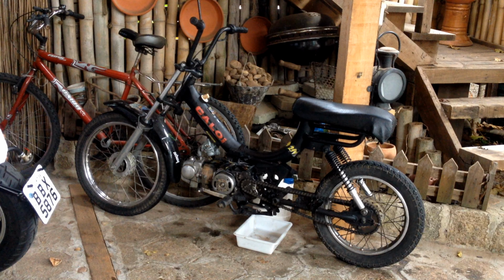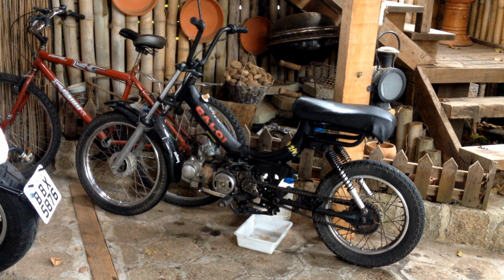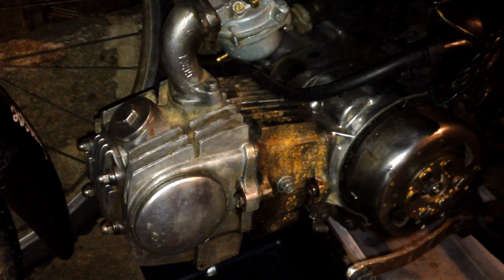And by high-octane, I mean it's the type of gasoline that they sell here in Brazil that has additives to clean the engine. It has detergents that will remove crud from the valves and the cylinder top and the cylinder walls. It's going to remove that crud, that carbonization. It's going to dilute it, and it's going to get burned off with the combustion. And of course, I was freaking out when I saw oil dripping from the exhaust, but then I recalled that I was running two-stroke mixture on this engine, and that's why I was having oil dripping out of the exhaust pipe. So here we are, very close and personal with this engine.